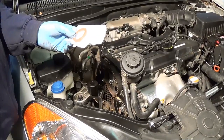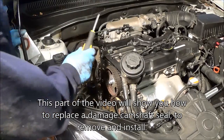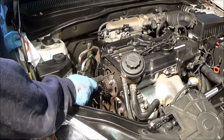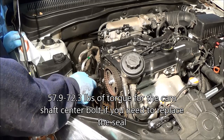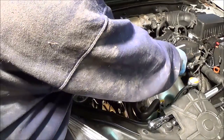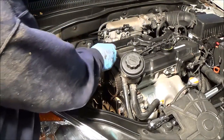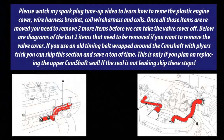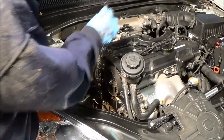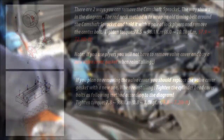You're going to take a drill to remove the other seal. You have two options here: you can use an old timing belt to hold this while you undo this bolt, or you can do the other option, which is take off this bracket right here, then take these bolts off that hold the engine cover — below there is all your valves and stuff, the valve cover. But you're going to need a new valve cover seal if you do that, and you can order those at Hyundai. Then you're going to find a spot right around this area where you put an adjustable wrench — it'll hold this from turning while you undo this bolt.